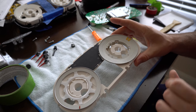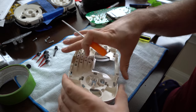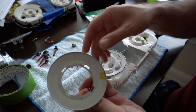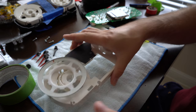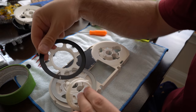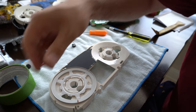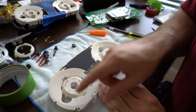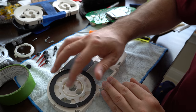To be able to get this out, I'm going to flip it over and use my pick tool. So that pops out - if you notice this popped out too, but that's no big deal, that's normal. So I'm kind of done with that. Here's the same setup from a donor cluster - if you notice it's black because that's how it is stock. So I'll just demonstrate - I take this out, see that little notch there. So I could put this on here - it's back to stock. This is for your cruise control indicator, it gets driven by this motor here.